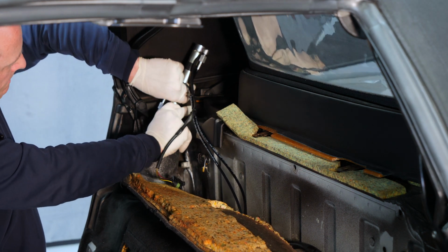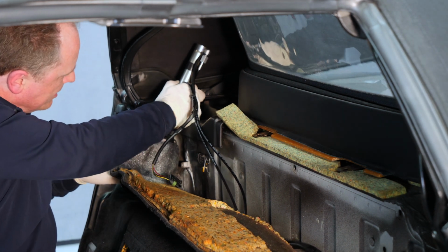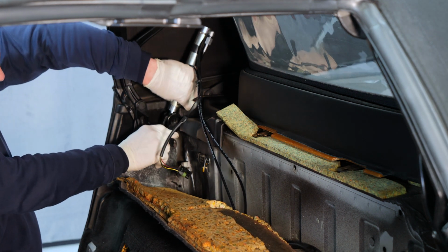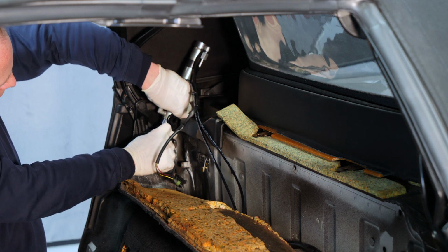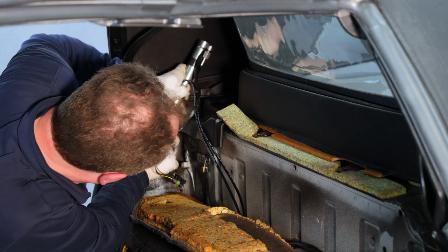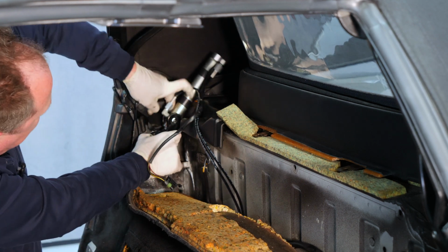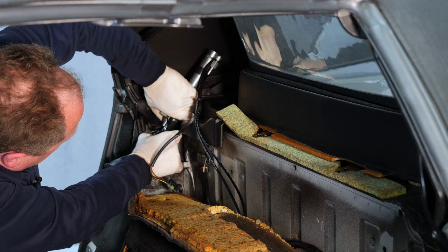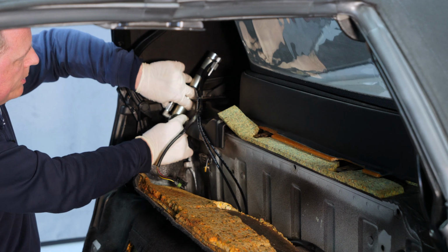we can now, oops, that's the demonstration effect. It just slipped out of place on me. So I'll do it again. It worked so nicely the first time around. So here we go. We move this cylinder until it seats exactly on the outer bolt. Fasten that outer bolt a little bit. Now put in the inner bolt.